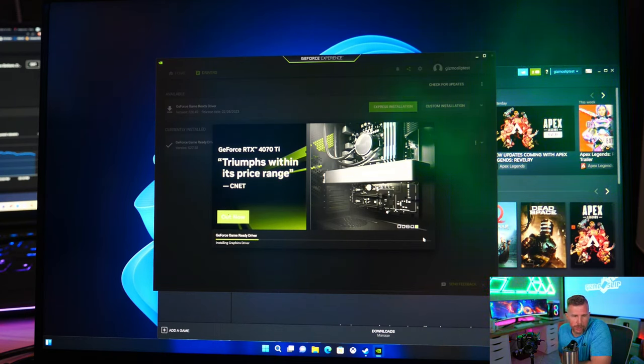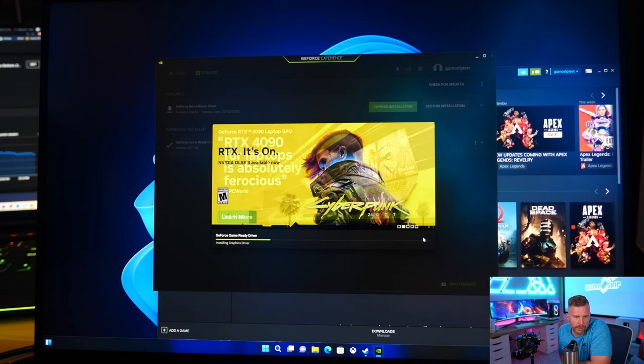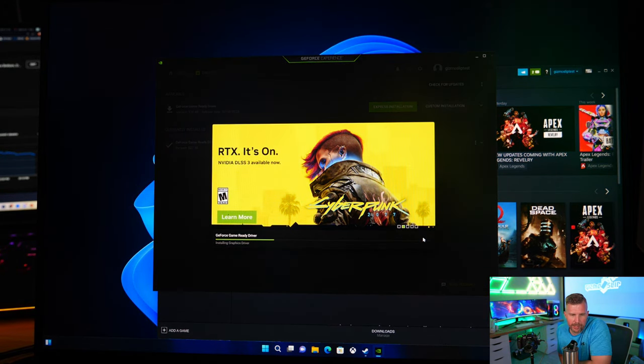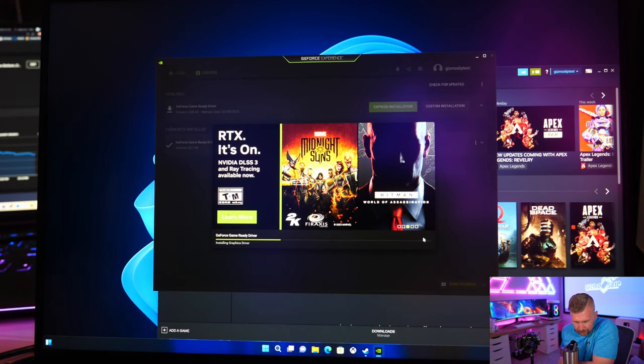Interesting. CAMM will allow 128 gigs with 4800 plus megahertz. Yeah, I don't understand the difference between CAMM and SODIMM. It'd be interesting to do some research on that. That's because DDR4 3200 megahertz is very low. Try 3800 megahertz CL14, then do a comparison. Memory speed is good for 7-Zip. Yeah, I mean, certain types of benchmark tasks are going to make a big difference. It depends on your use case, but it was a pretty big difference between 4800 and 5600. Interesting.